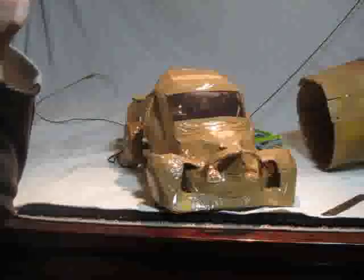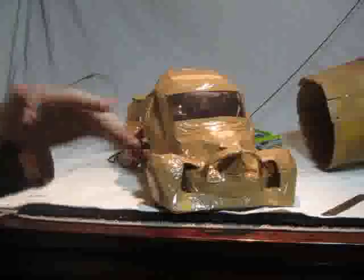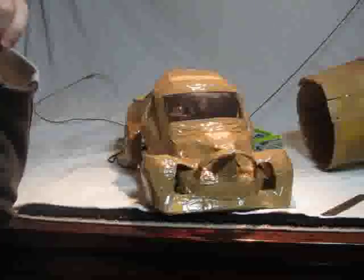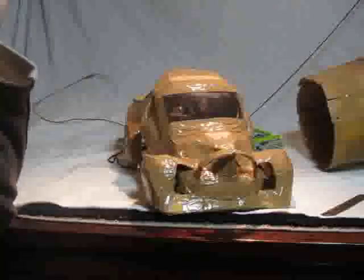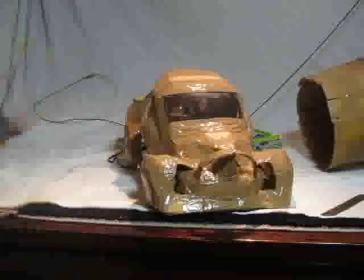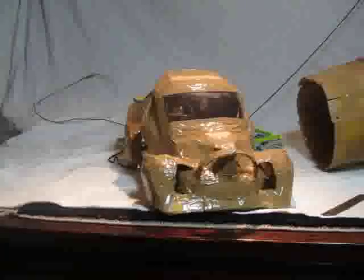The drag coefficient is roughly 0.25 and the frontal surface area works out accordingly. For low rolling resistance tyres you can get quite good, cheap eco tyres with a rolling resistance coefficient of 0.007 — that's achievable. The plan is to make it in fibreglass and then either do it as a kit car if we can't find a manufacturer, or take it to a manufacturer and get it done. Thank you for listening.